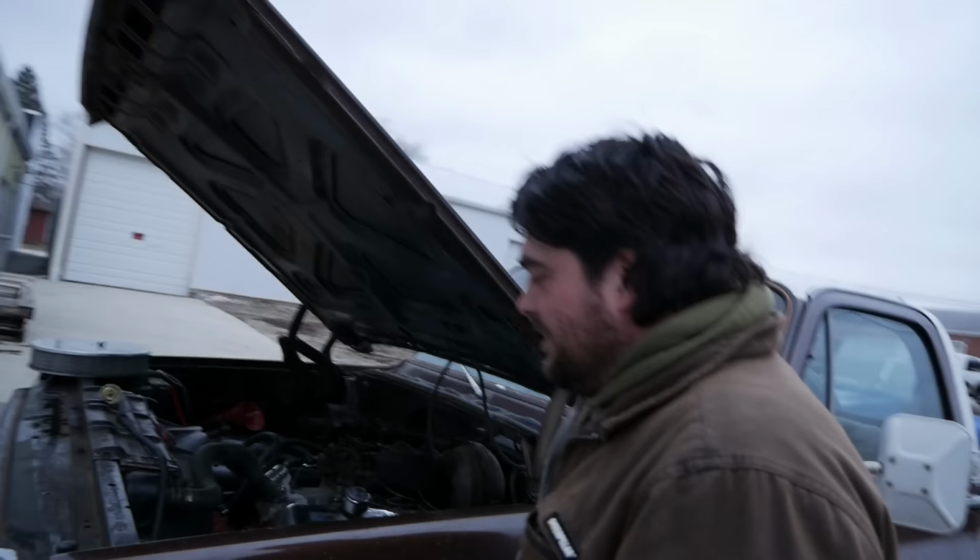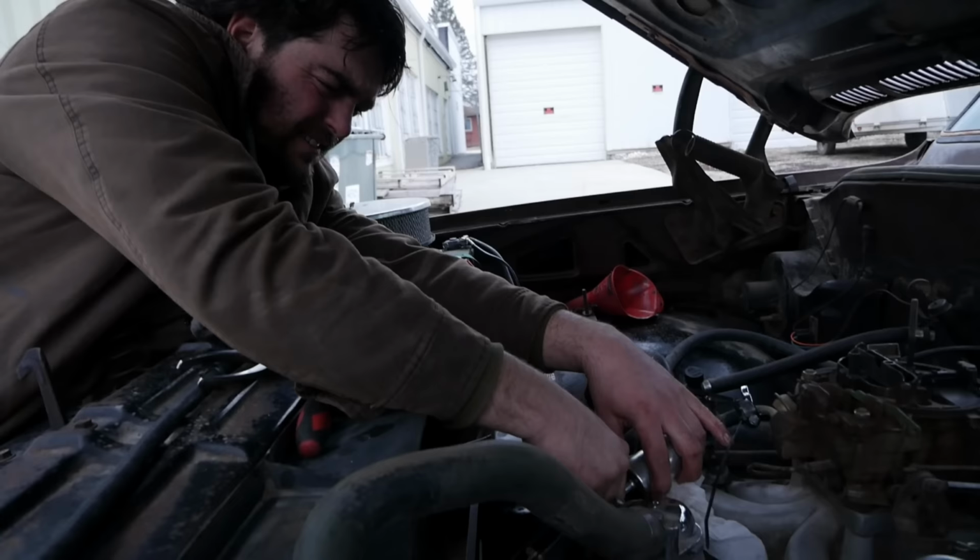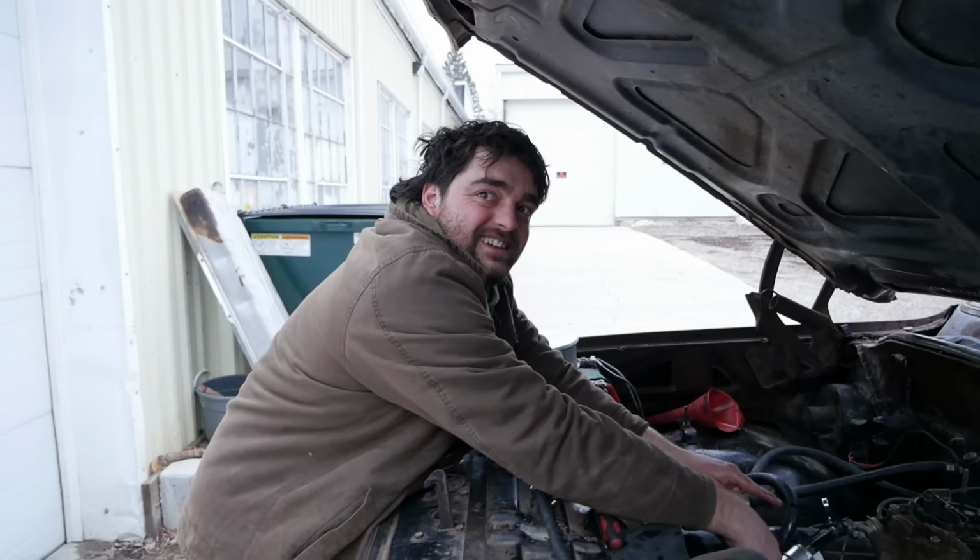What'd you find? It's got lots of pressure on it. Lots of pressure on the carb. Nice. Look. A little warm. Whoa. I think it's the needle and seat. Well, that's enough pressure in there to be vapor lock.